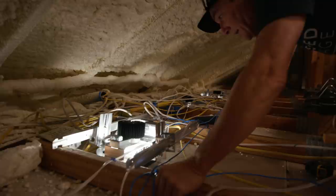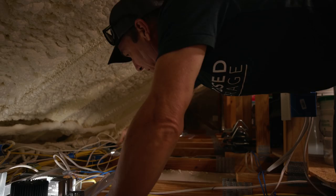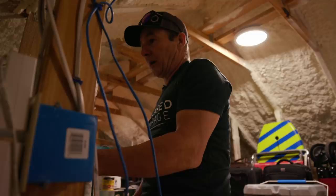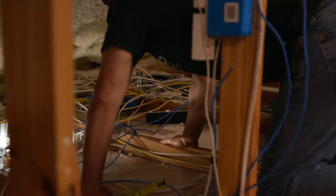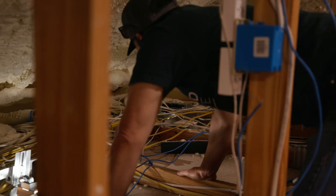So that means we're going to have to put the blocking to your right. Yeah, it's going to go in this bay. All right, so this one will block to the right. And so we need to come, what is that, 6 inches off the stud. Off the box is where the stud is. Actually, center of the box is 5 1/4. But we're going to come inside, so we're going to come to the right. So our hose reels are going to be mounted basically between those two studs to the right, so we can catch two bolts here. And then the other three sets of bolts in the blocking would be good. And then the same situation would apply over on the other one.